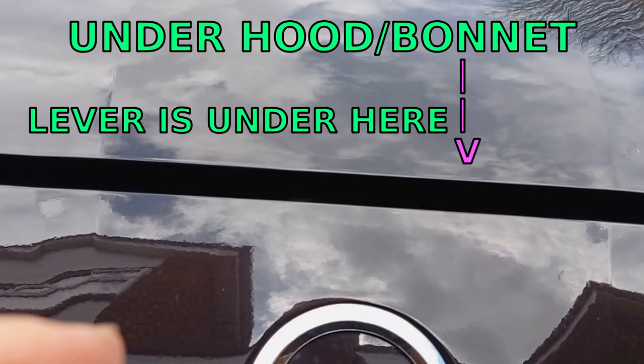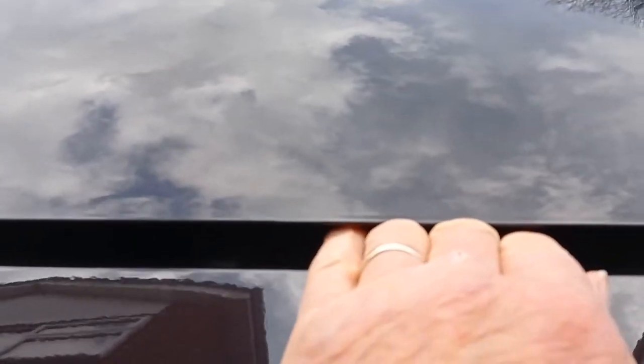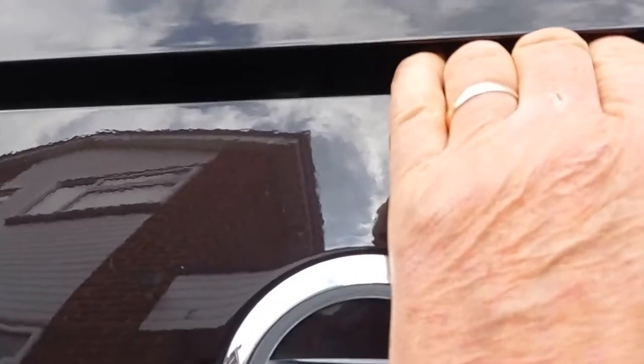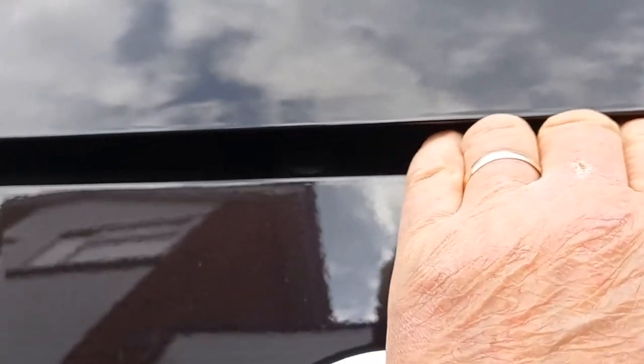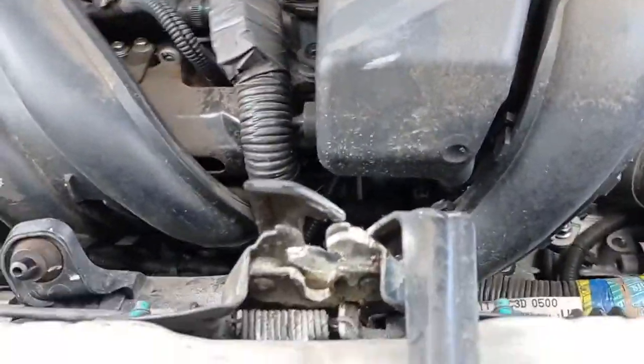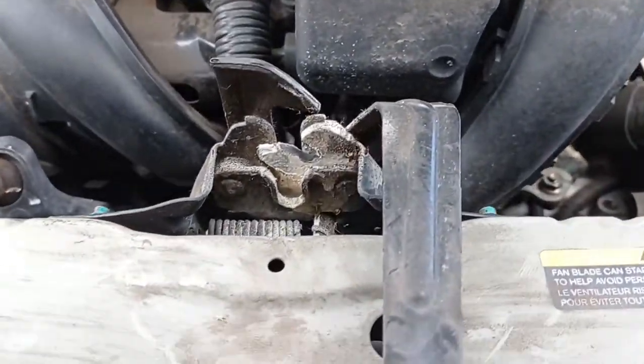Come round to the front. Just above the badge — off to the right — my middle fingers are on either side of the lever. You can always peer through the gap if you're really stuck to see where the badge is. There are my fingers and the lever is attached to the body of the car, not to the hood itself. So it's just a lift to the center. That's the lever your fingers were looking for, just above the badge. Very straightforward.